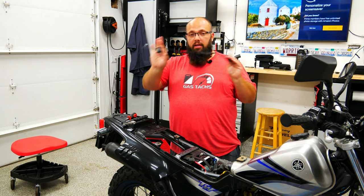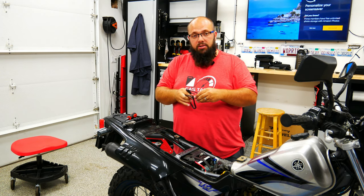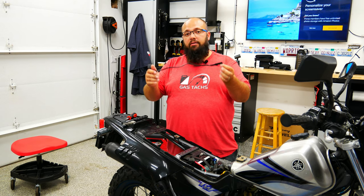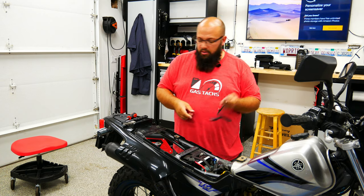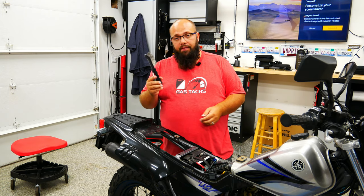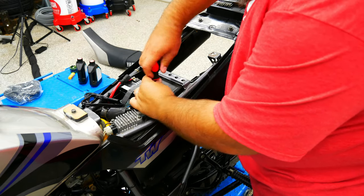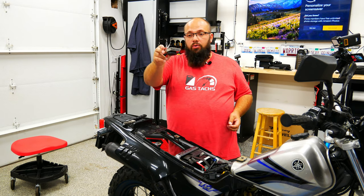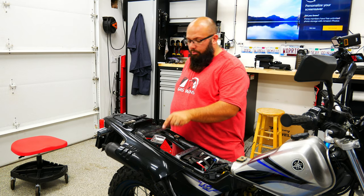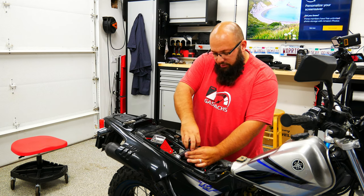Here is the tender that I use — the generic tender plug. I have one of these on all my motorcycles. I live here in Chicago, so six months out of the year we don't use them. If you don't have one of these on your motorcycle, I'm sure you're wasting a lot of money buying batteries every year. Pretty simple — let me just unscrew this battery, clean up the terminals, and then we can just install that and figure out where we can tuck it away. I utilize these little magnetic trays in the garage all the time to hold your loose nuts and bolts. Now the battery ones will be in there for when I need them — that way you can never lose your stuff.